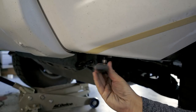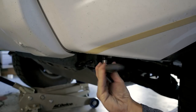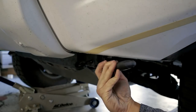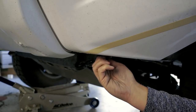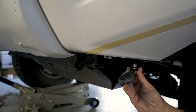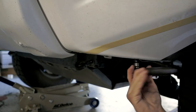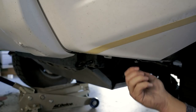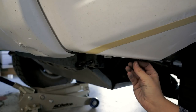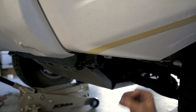With the next step, prior to cutting, you are going to want to remove the two bolts that fasten the front face of the bumper to the metal attachment that comes off from the crash bar that sticks out into the front of the vehicle. This will ensure that you do not make contact with this metal frame when you begin your cutting process.